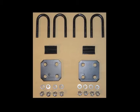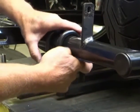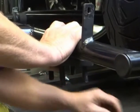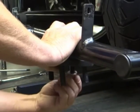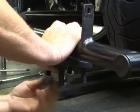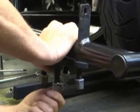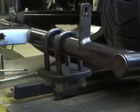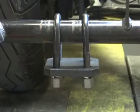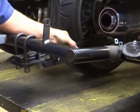Locate the four suspension U-bolts, two lock blocks, two suspension plates, eight hex nuts, and eight lock washers. Place two suspension U-bolts over the rear of the Voyager frame and through the suspension U-bolt plate. Hand thread a hex nut and lock washer on each suspension U-bolt end. Do not tighten at this time. Place the leaf springs on top of the suspension U-bolt plate and underneath the Voyager frame.